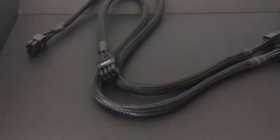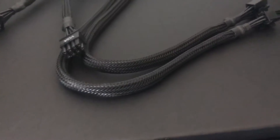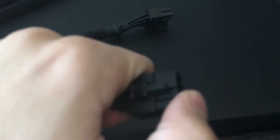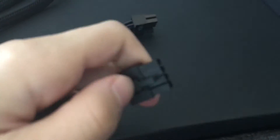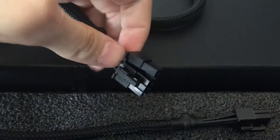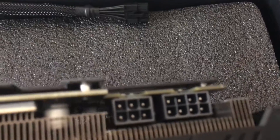So I got my two VGA power cords from my power supply. Keep in mind, the power supply I'm using is fully modular, so there are different models — just keep that in mind. As you can see, these are 8-pin, but you can just detach and attach one of them to get a 6-pin one. Because the power connector on this card is actually one 6-pin and then another 8-pin one.